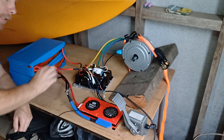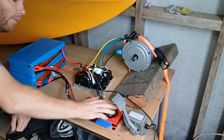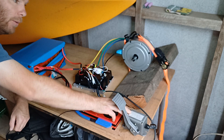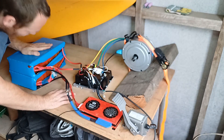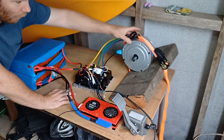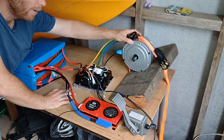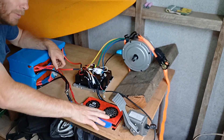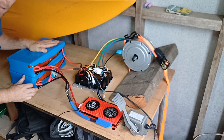So this is the complete electronics for the quad bike. Everything's all here and working, which is great. I did get a foot throttle because it was originally going to be a go-kart project, but now we're doing a quad bike so I'll have to get a thumb throttle for it. We've got the custom made battery using 21700 cells — I think about 208 of them all up. We've got the Easy Control controller, the three kilowatt brushless motor which I'll be running at about four and a half to five kilowatts — about 5000 watts. We've got the 200 amp BMS, and then the battery has all these balance leads into the BMS.